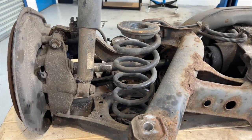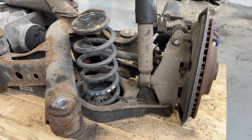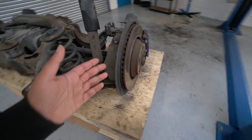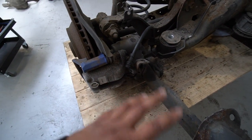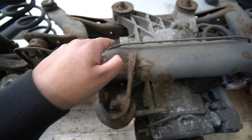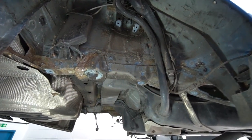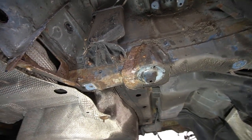The suspension is still all kind of attached — the springs just sit under tension between the lower arm and the body of the vehicle. These all look pretty new as they're not flaking. The dampers are a bit more tatty, but most of the time people change the springs because they crack. One damper looks a bit sweatier than the other, so perhaps it's more past its expiry date. The brakes are still attached too — these are the 310mm vented rear setup. The Passat B6 has an electronic handbrake, which is quite an odd thing for a car of that era. The brake pipe that snapped runs all the way along the top of the subframe. There's quite a bit of surface rust on the wheel arch area as well, though it should basically scrub off with a wire brush on a drill — nothing terminal.